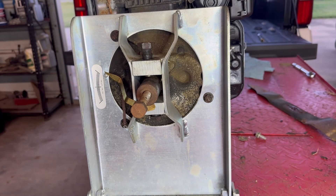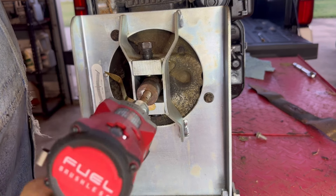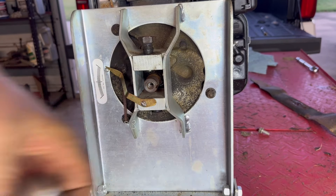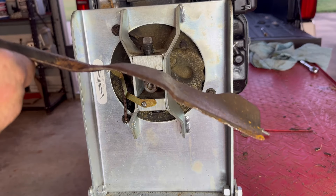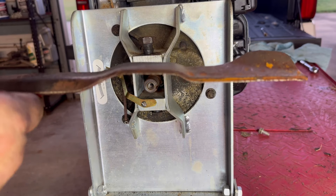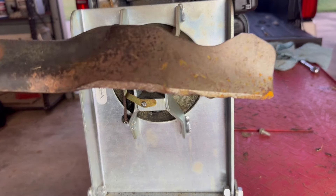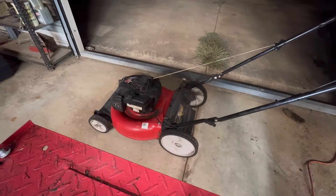We need to get this adapter off - in my experience that thing will get swedged on there pretty good. There we go. This blade is definitely going to need to be replaced - it's bent to Hades and back, you can see the curve in it right here. All right guys, I'm going to have to run to the Home Depot and get a blade for this guy's lawnmower. Y'all stay tuned, I'll be back shortly. When I get back, all this motor and stuff is going to be put back on the deck and all we're going to do is put a blade on it and crank it and see if we fixed the vibration.